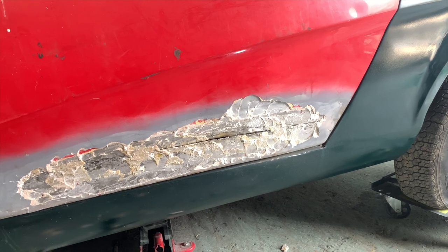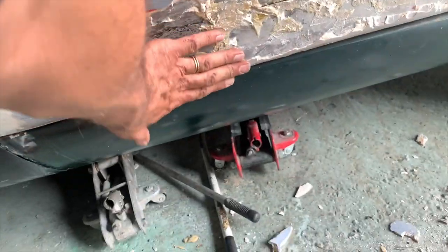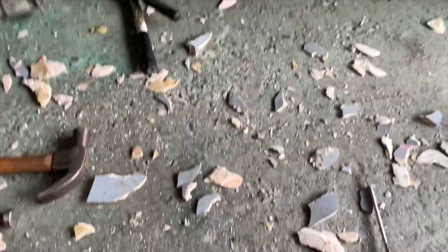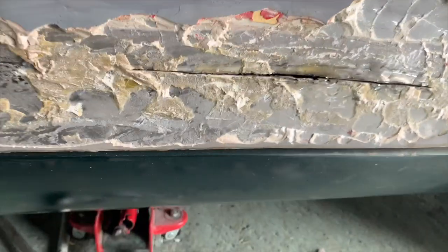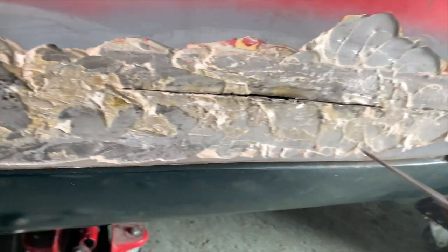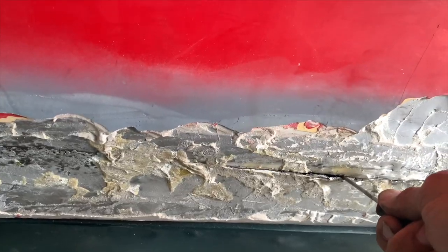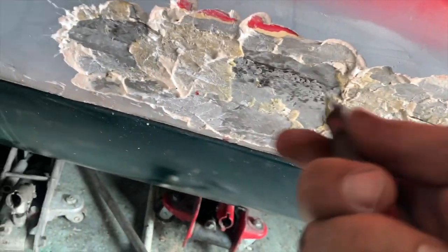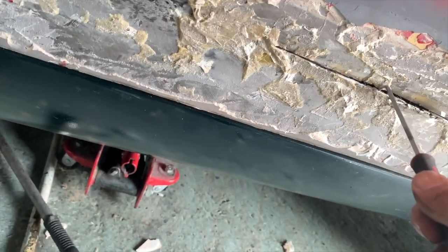The plan today was to just get that door fitting a bit better, and in doing so — in terms of bending this in so that it touched a bit better at the bottom — I ended up taking out all of this awful work I'd previously done. I've started cutting through my weld here to try to pull this out, and I just want to show you why. So when I get this in here and pull this, there you can see when it suddenly pops. So it should be out more like this at the top. In order to get that out, I think I'm going to have to continue cutting a bit further along and then pull the bottom out a bit so that it comes out.